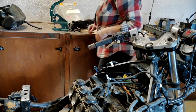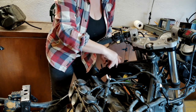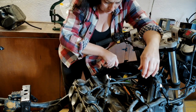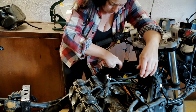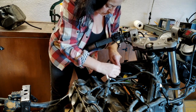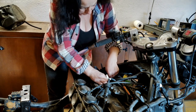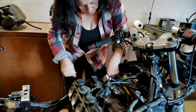What did I do with the spark plug spanner? So, this spark plug spanner. Alright, this time we're tightening up, but not over tightening, and definitely do not cross thread the spark plug. Not going to do it too tight. Then put the lead back on, press down, make sure it's secured, and you hear it go on. Okay, because you don't want anything getting in there. Okay, that's clicked on properly now.